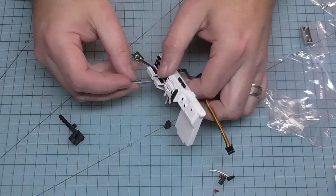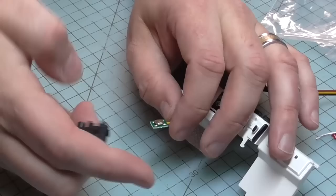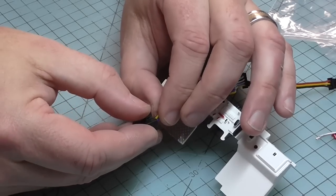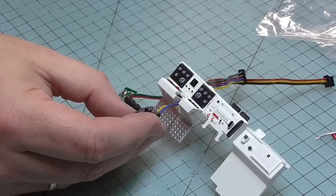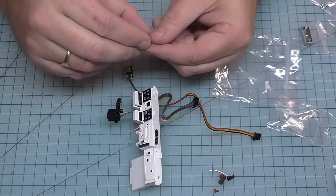Bringing back over the dashboard, the control board we just put in - we're going to put the switch part behind that horn button, so we slot this in all the way. Now when I press this you might hear a click - that's operating that switch, no problems at all. I want to close off the other side to stop that board falling out with this tab here.